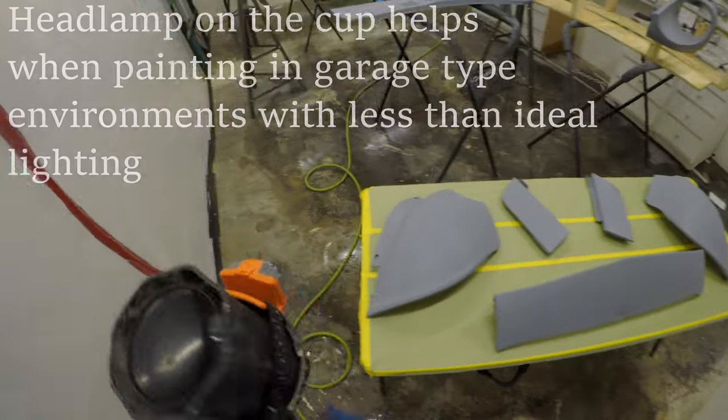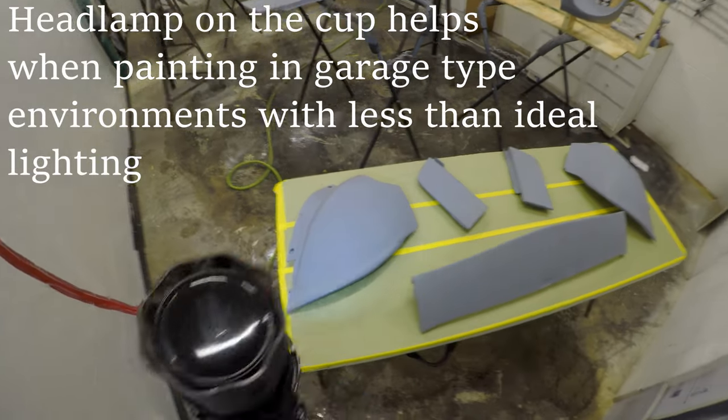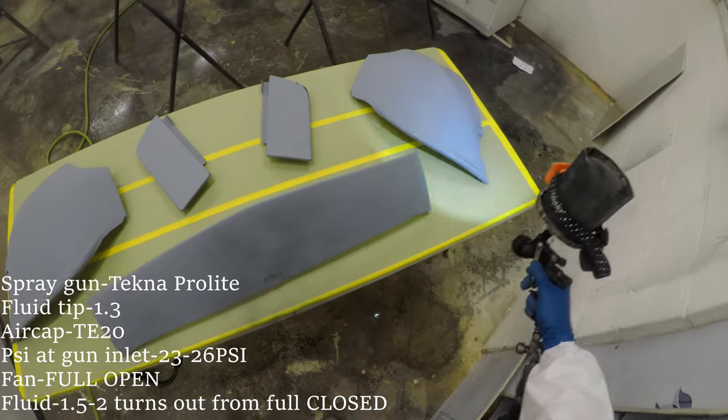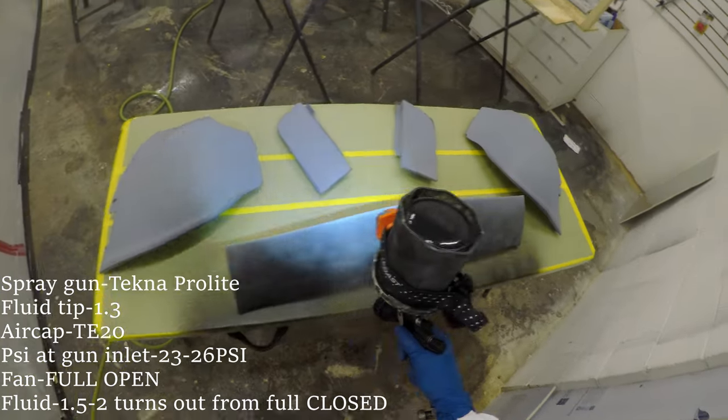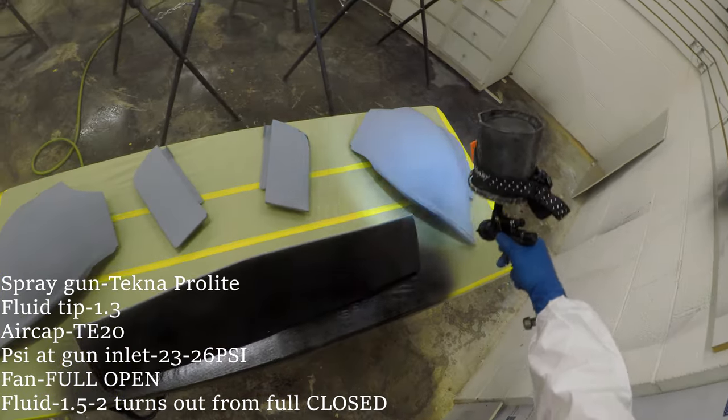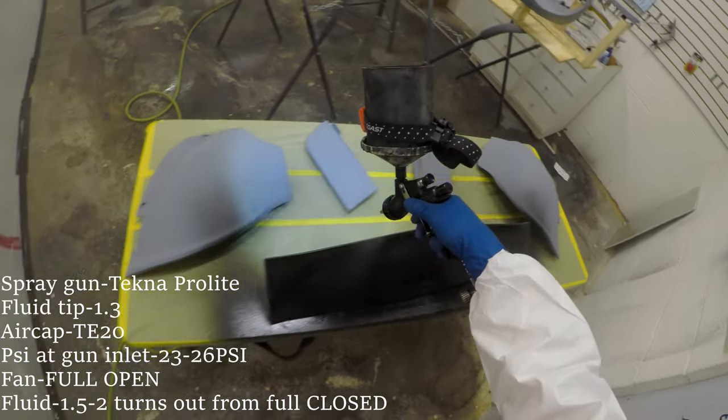And that is all a base coat is trying to achieve, is color coverage. You're not trying to cover the entire vehicle and make it change appearance. You're just providing enough color coverage to where you can clear coat on top of that and give it one uniform look after the clear coat is applied. So we're not doing that today.